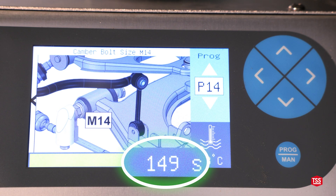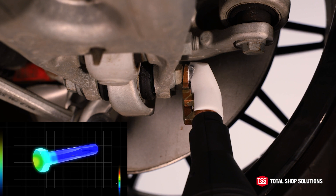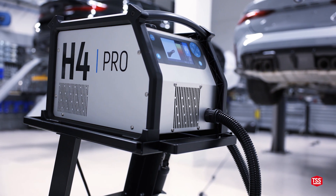The preset programs apply heat with low power for a few minutes. This way, heat is distributed more evenly and reaches into all parts of the material without causing overheating. In this way, the parts retain strength and stiffness, which means higher quality repairs and safer vehicles.